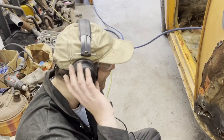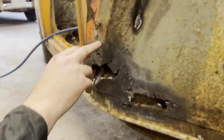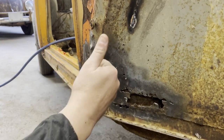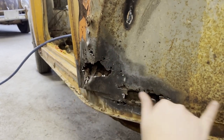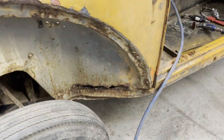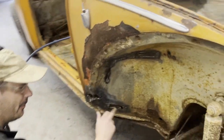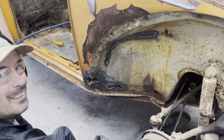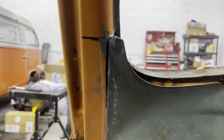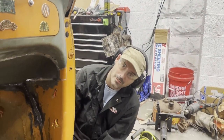We can actually use the existing shapes to form the metal and then put the patch on. We can't get to the back of it otherwise we'd be able to just put it on and push the old metal in. But we can do a nice little template there — this is pretty straightforward all the way along and it's actually fairly solid, so that's not bad. We'll see how that goes. The other side's worse, yeah — it doesn't have the pillar damage but it does have to get along here. All right, while he's doing that I'm slowly getting the dash welded in, one little bit at a time. I gotta keep following this down here — techy techy, cutty cutty. We're both gonna be throwing sparks around the shop.